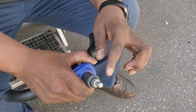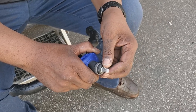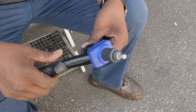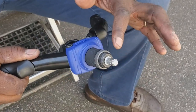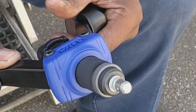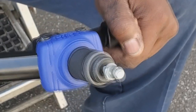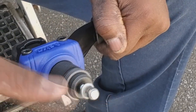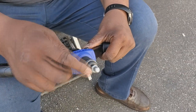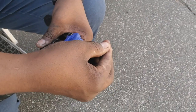Now, what I recommend is when you buy these studs, get a few of them. You need 6, I recommend buying minimum 10 so that you can experiment and play with it. What I want you to do, so that you can get a feel of how much force you need without over stripping, watch it, and then you can feel the force that it takes to pull that into position. And see how that's a little bit on the edge? So now you can kind of tell if you need to. Now, this would be when you look at it from the inside and you can see that it's not completely flat and gripping, so you can tighten it a little bit more if needed.